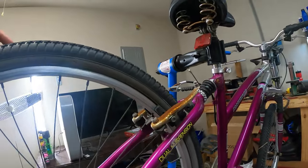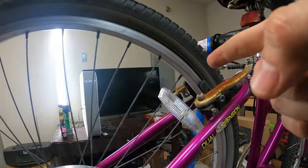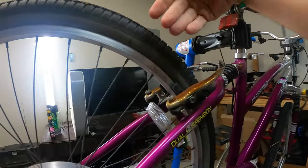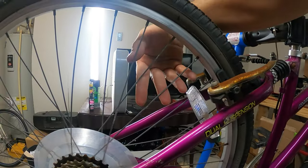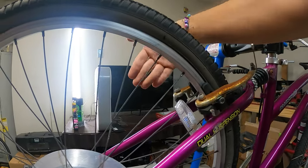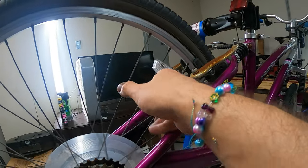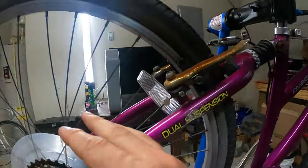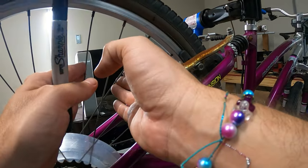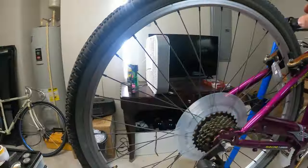So it's a pretty simple situation, I guess. This zone here needs to go that way. You either can pull the wheel that way by tightening these spokes, or you can loosen these spokes and allow the tension that's already here to pull. What you should do, if you know the tension is always correct, is loosen these, and then the same amount tighten the other. So I think that's what I'm going to do, to try to move it over.